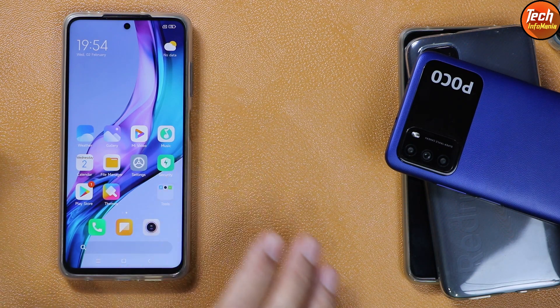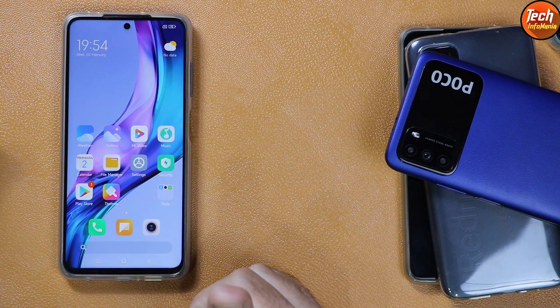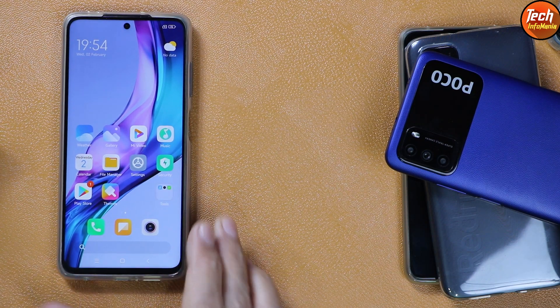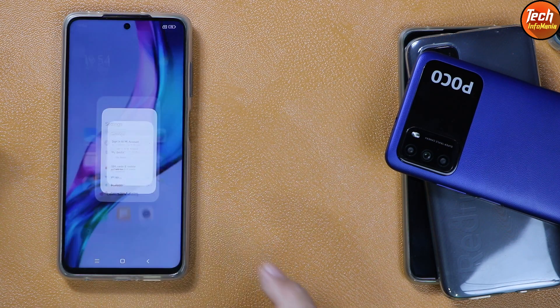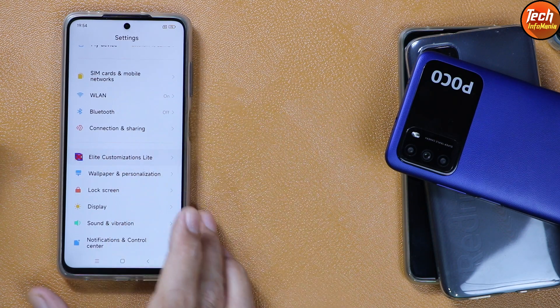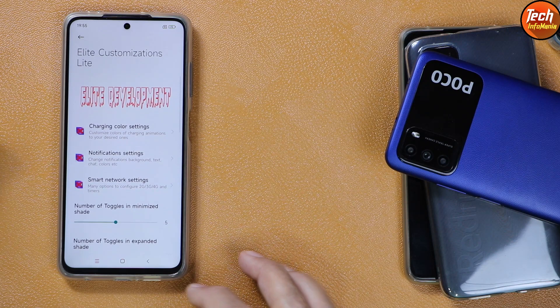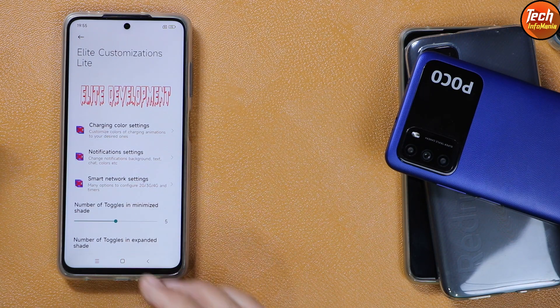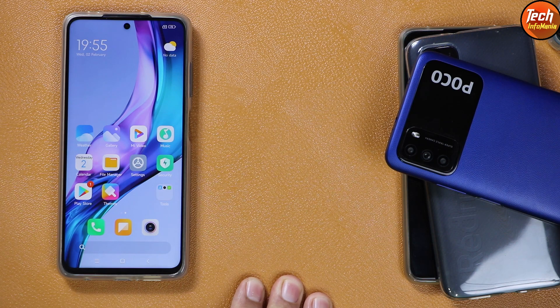After the ROM boots, wait two or three minutes with the device on the table, then log into your Google account and start downloading your applications. The performance gets much smoother and better after waiting a couple of minutes. In the Elite customization section you can see all the customization options to set the ROM exactly how you want. This was a video on how to flash MIUI 13 ported ROM on Poco X3 NFC. Don't forget to like, share, take care of yourself — see you in the next video. Goodbye!